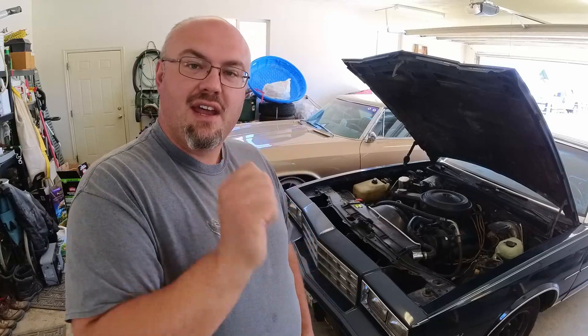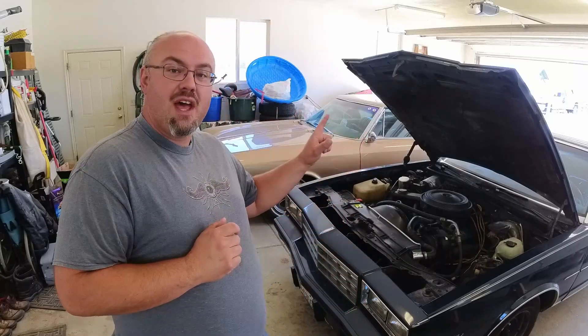This 1981 Chevrolet Monte Carlo is suffering from probably the single most common ignition failure of any GM anywhere, especially if it's equipped with an HEI. Went to start this morning to go get groceries, just do normal life things. Crank, no start. Pull the spark plug wire, pop the spark plug in, test it against the ground — we are out of spark completely. I'm pretty sure I know what it is. It's got to be the ignition module, so I got a new one from AutoZone. Let's get the cap off and take a look and get this swapped out.